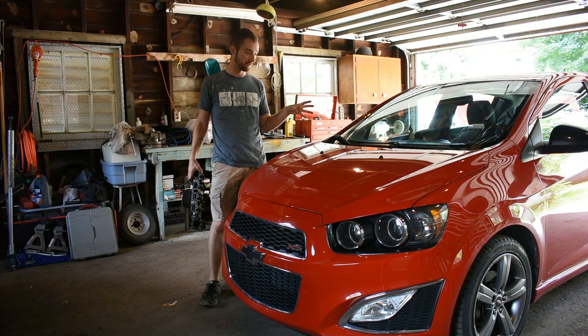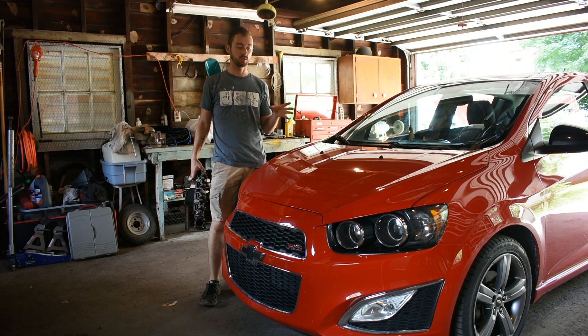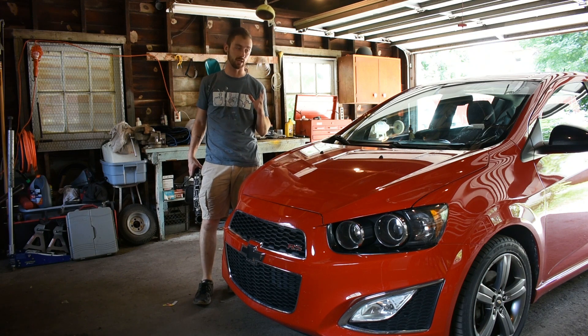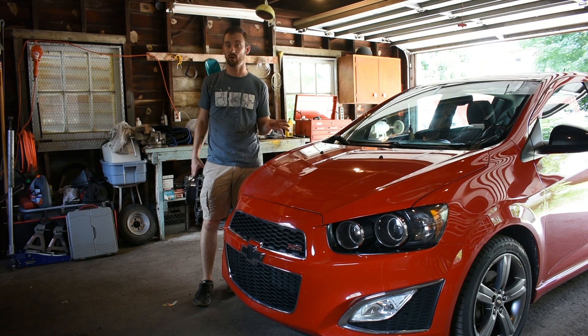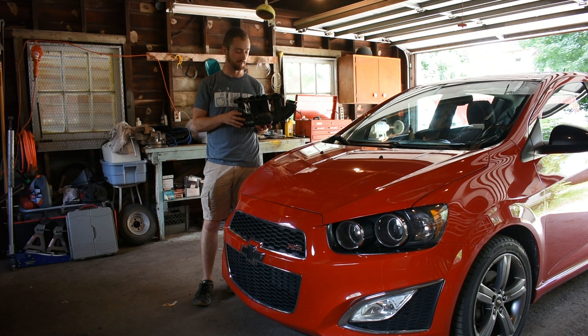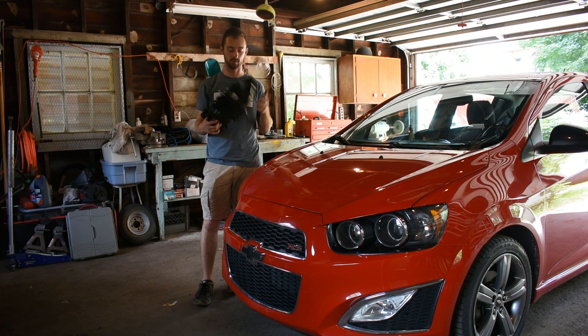Definitely faster. And with this piece, I should be riding around 200 horsepower — which is pretty exciting for not even upgrading the turbo or anything. This car being at 200 horsepower, originally starting at 138 stock at crank — I think I'm at 200 wheel horsepower. I've never dyno'd it, but I'd be interested to know. Super exciting. Definitely worth it. You don't actually have to buy a new one — you can take yours off and get rid of those walls and that casting flash just using a Dremel.